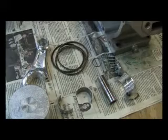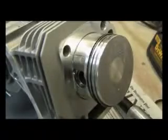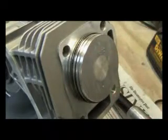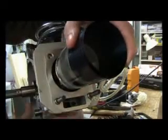Next, assemble the piston and connecting rod. When installing the piston rings, make sure the numbers on the ring face up. The order of the rings goes chrome, black, then the oil rings. Make sure the ring gap is positioned at 12, 6, 3, 6, and 9 o'clock starting with the top chrome ring. Be sure to install the piston with the dot facing down. You can use a popsicle stick or a ring compressor to squeeze the rings into the cylinder. Make sure the crankshaft is positioned to take the end of the connecting rod, then tap it in.